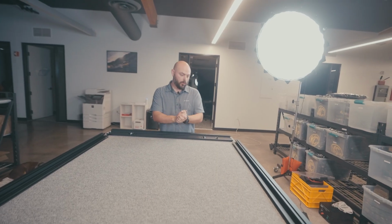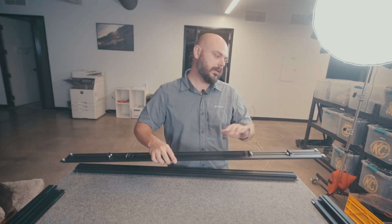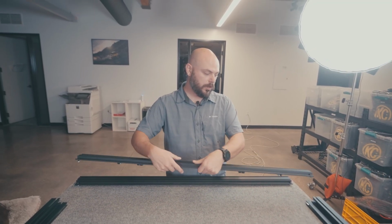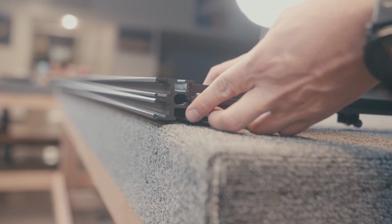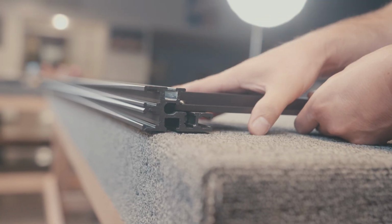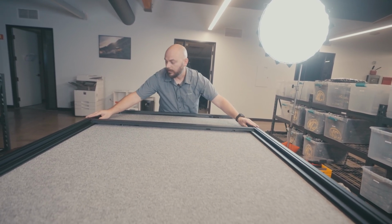All right, lower horizontal support rails. That's these guys that we already worked on at one of those earlier steps, and install the brackets into. So what we have right here is on the ends, we have our nuts. So we need to flip this over and slide these nuts into this little extrusion here on the perimeter side rail. Then at this point, you just have to use your thumbs and guide it along the track here and get it all the way in at one time and go evenly. Don't push one side and not the other. So that's pretty much it.